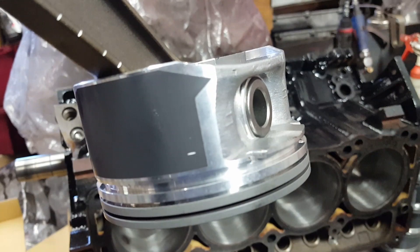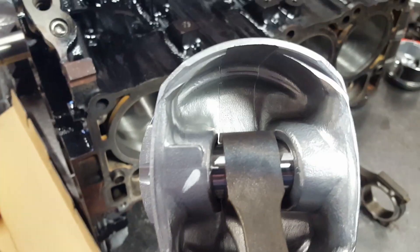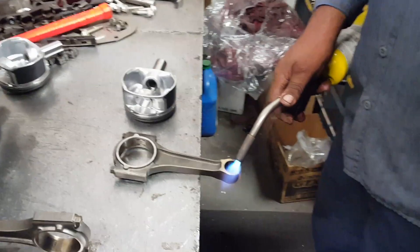Perfectly equal, see it right there. The other side has no stop, so you have to put your finger back on the other side of the connecting rod. You want it right in the middle of the pin on the piston, right in the middle. You can use the same method for any other piston and connecting rod with a pin — always preheat and push in by hand.